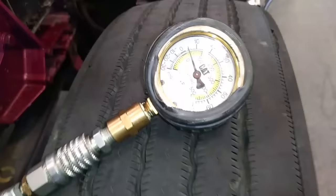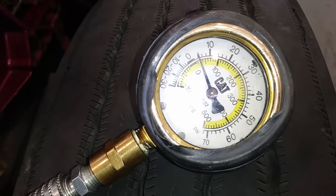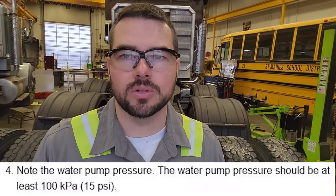Very weird. I was pressure-reading the cooling system while troubleshooting it, and it never got above 9 PSI — it's supposed to be 15 PSI in the block while running. Also, the upper radiator hose never got warm. But the vent tube that goes from the thermostat housing into the water pump did get warm, so the stats seem like they're opening. It's not flowing any coolant. It does have a new water pump, so it's very weird.